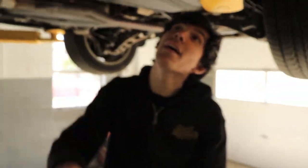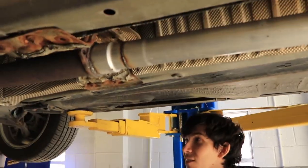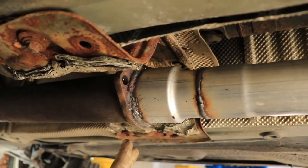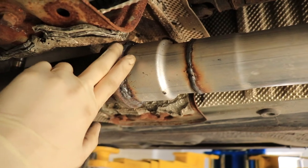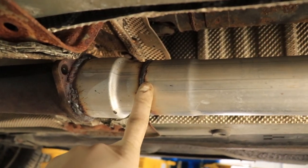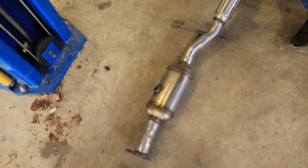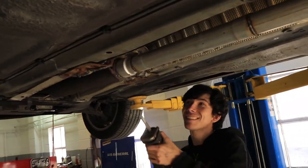What does Nate think? It's just a Volvo for you. Upon further inspection, we figured out what we're going to do. He's going to do a cat-back exhaust eventually anyway, so what we'll do is cut it off here and grind it down so the flange is usable for later. Then we'll cut the flange off the cat pipe so we can slide that pipe all the way into the section where we can put a clamp on it — easily removable later. We'll need a little extra line because it'll be too short. Here he goes with the Kimble blades.